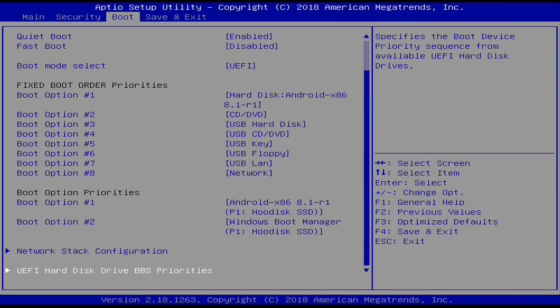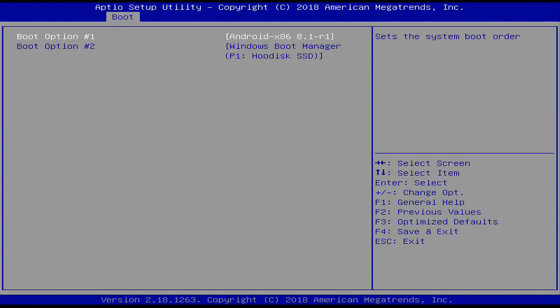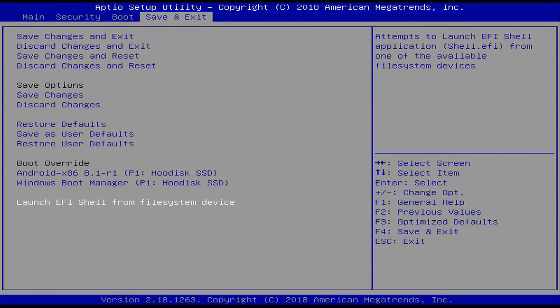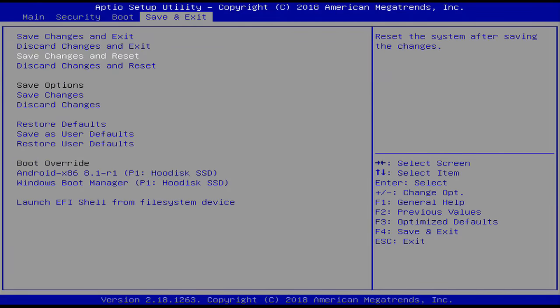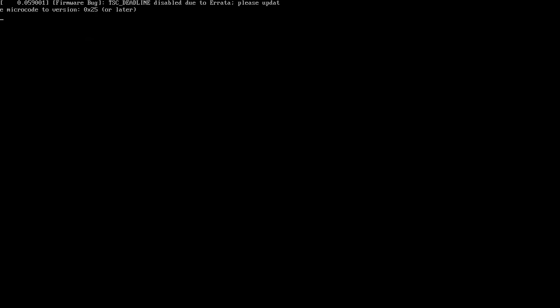Well, I have done it again, and this time I did it the same way by using the storage expansion bay on this PC. I installed the latest version of Android x86 onto the 500GB SSD in the storage expansion bay, and set the BIOS to boot directly off of the SSD and not the M.2 port, thereby preserving my Windows 10 operating system, leaving it untouched.